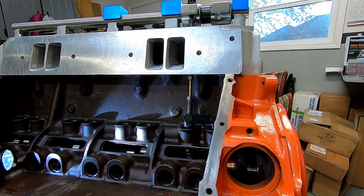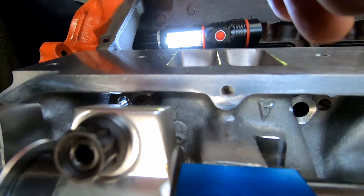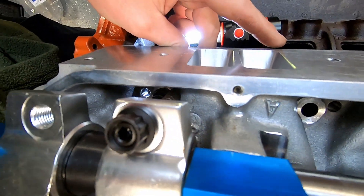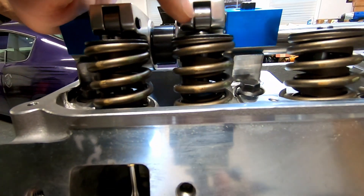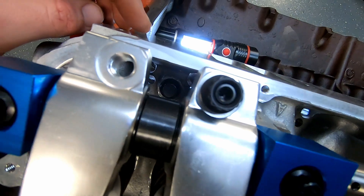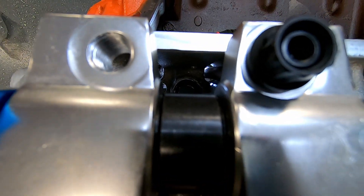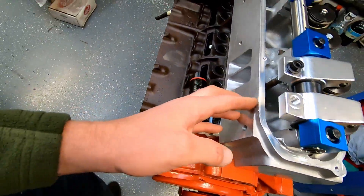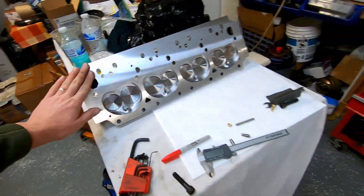Now we can pull it apart and check it. At this stage I went ahead and slid my light under here — it's also good to be able to check the push rod-to-wall clearance, the sidewall clearance. If it needed a little more side to side, I could cheat and put another spacer in here. I really want to try to keep my roller centered on the valve stem. I'll do another video on setting all that up, but the up-and-down motion of it right now looks like it has plenty on top and bottom.